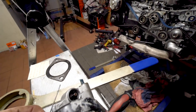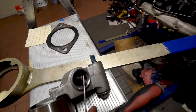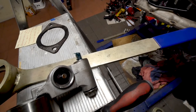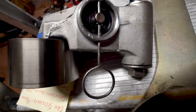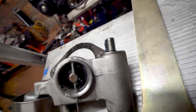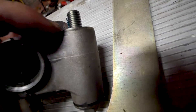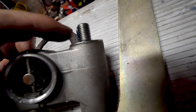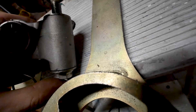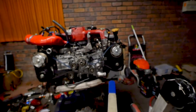You've got to make sure you get one of these grenade pins. What we want to do is push this in — I'm just going to use a vice and slowly wind it in, then put that through so that it's not fully tense. You can see the grenade pin is through just to the other side. There's also a little rubber O-ring that holds the washer on. It's a good idea to put a little bit of grease on there and on the inside where it moves. Once that's done, it's ready to go back into the engine.